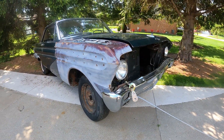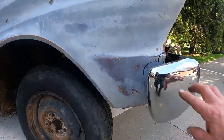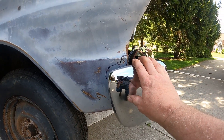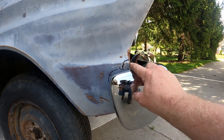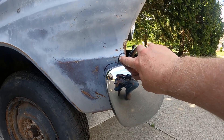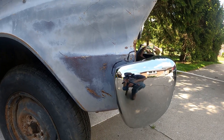I got this thing tied up to the back of the truck on the trailer hitch, and to the front bumper, to hopefully pull this thing down and out. I marked where the bumper is currently with this black line. I measured from the other side — the good side is all the way up here just past the body line. The bumper needs to go about two and a half inches forward and about an inch and a half up. That's the plan.